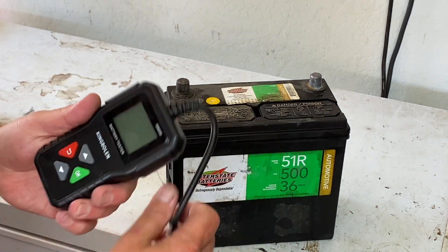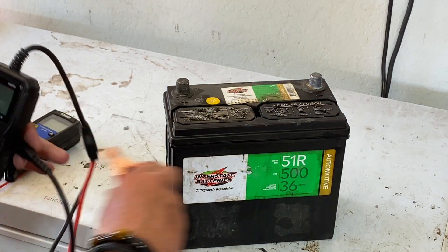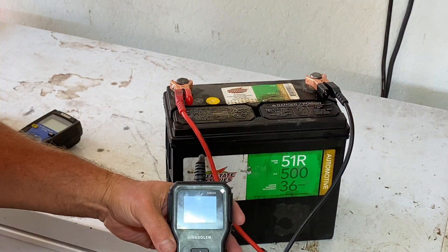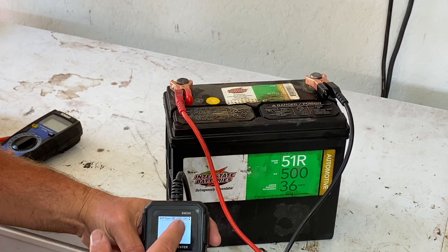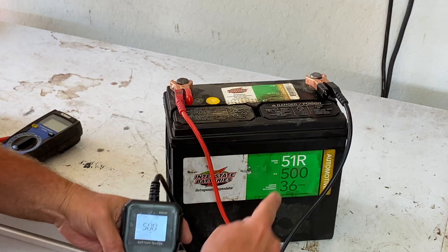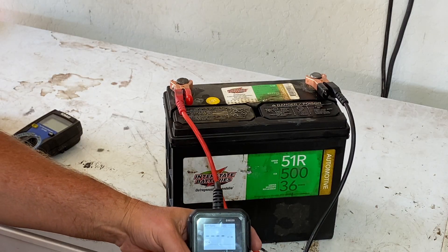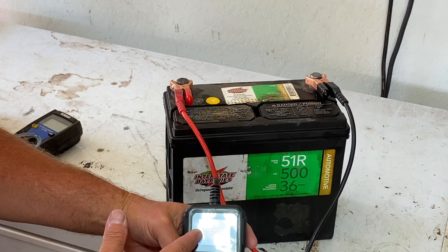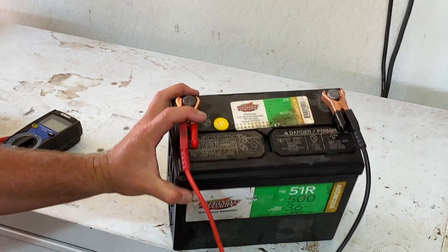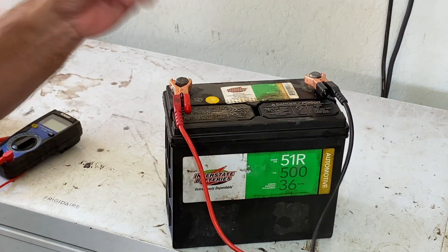Here's a cool little battery tester — you want to get one of these for yourself, there's a link down below. Same principle: put that onto there and it lights up automatically. Select 12 volt, hit OK. 500 cranking amps, hit OK. This is going to tell you if the battery is good based on cranking amps. 56 out of 500 available — and it says 'poor.' The date looks like 8 of 21. That's an old battery. So how are we going to fix this? Let's get into that.